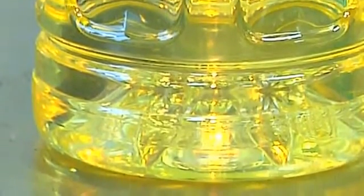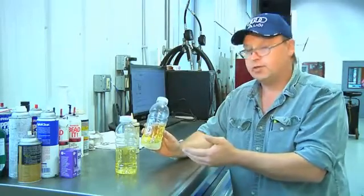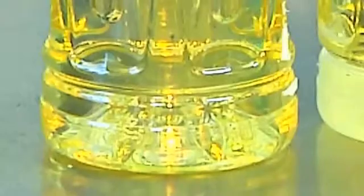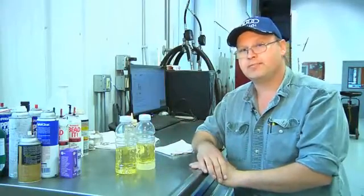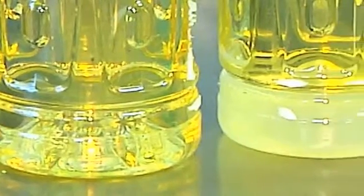One of the ways we can eliminate the water in your gas tank is to install isopropanol or dry gas. We do this when the temperature changes, because that's when the gas tank is most susceptible to condensation inside it. Most of today's modern cars have an evaporative emission system that keeps a positive pressure on the gas tank, so water in the gas is not as big a deal as it used to be,